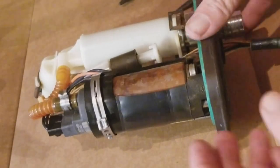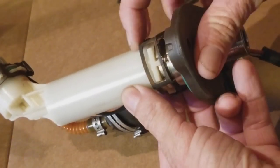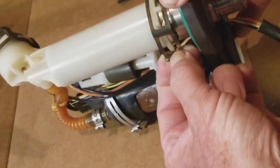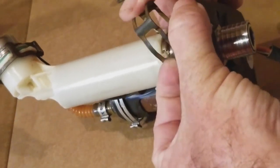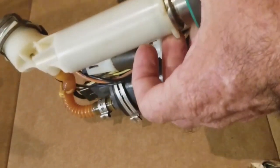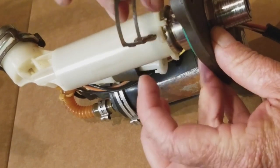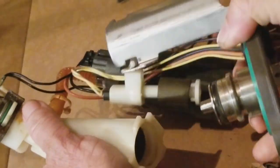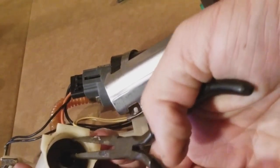Okay, guys, so we're going to start with the fuel filter, and right here, this clamp, it's pretty easy. It sets in like this, and all you got to do is bend it outward, get it over that, and it pops right off, and you've got two sides to it. It's pretty easy to remember because you've got 1, 2, 3: you've got one on your side here, your middle center, and then your back. So pop that off, and then just grab that thing and take your time, pull it off, and there is our fuel filter.